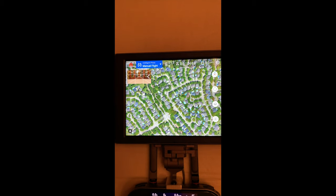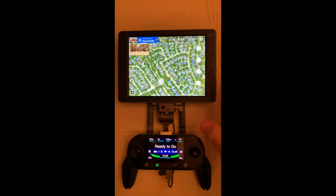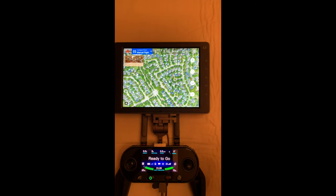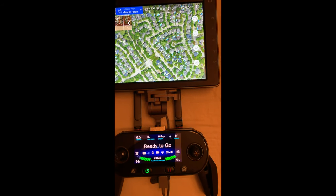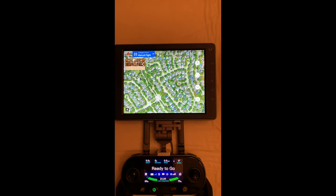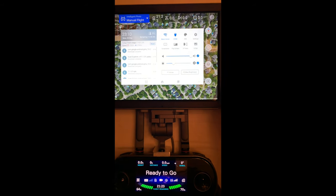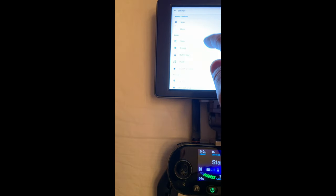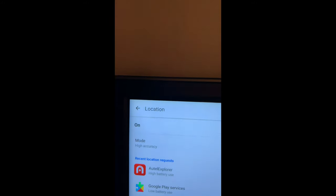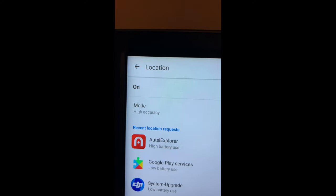So it was a blank screen. Here's what I did — I think it's probably necessary. I had to take the DJI Crystal Sky outside and take the Evo 2 Pro drone outside so they had a clear view of the sky and could see GPS satellites. In my neighborhood it's kind of crowded, so it only sees 10 or 11 satellites with the drone sitting on the ground. You also want to go into Crystal Sky settings, under Location Services, and make sure that location services are turned on — I have it in high-accuracy mode, but I believe any mode will work.